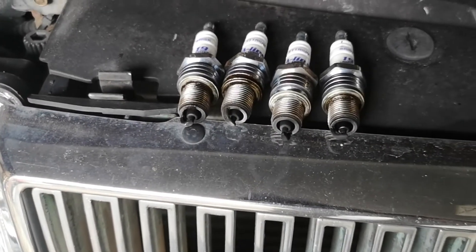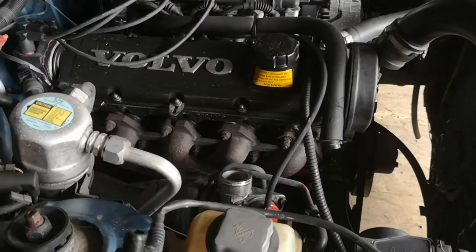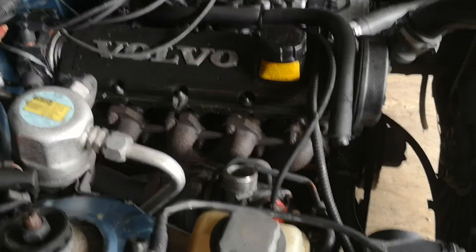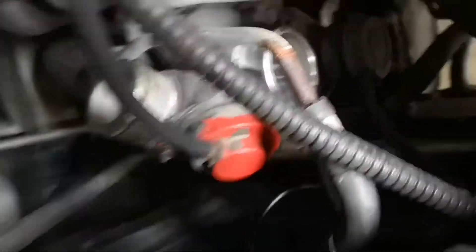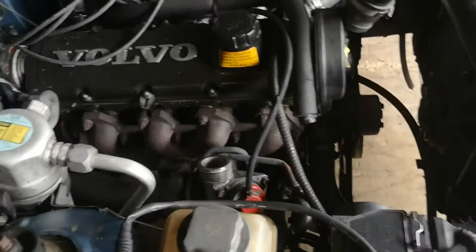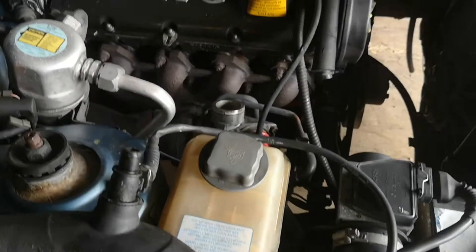The other plugs are equally oily and dirty, so it doesn't look like we have coolant in any specific cylinder, which is a good sign. I also noticed this car smokes a little bit on startup — you'd expect that to be the turbo, but the turbo looks clean and has a little bit of play. I think the one in the other turbo brick is actually worse.